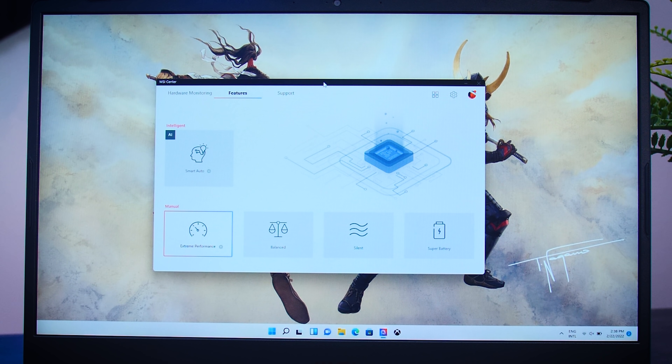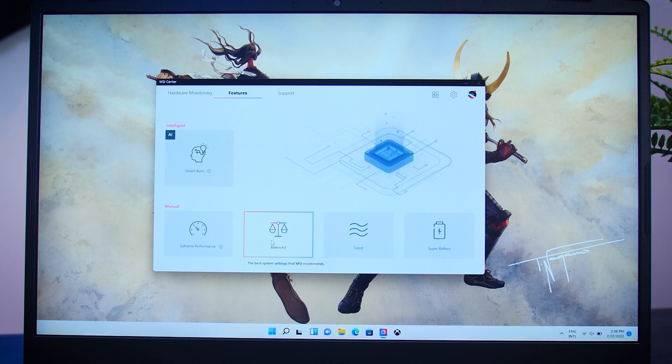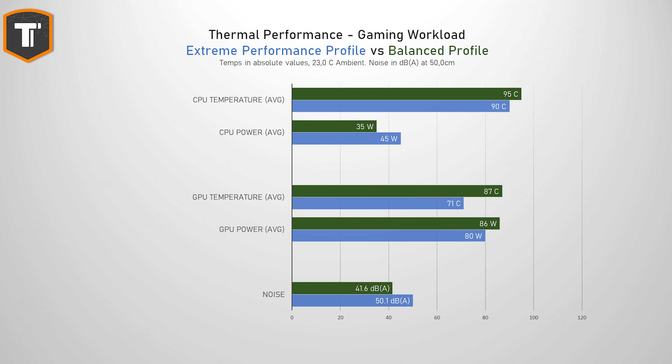You get several performance profiles to choose from. In extreme mode the thermals are reasonable — 90 degrees on the CPU is still pretty warm, but way better than the high 90s some earlier models had, and 71°C on the GPU is completely fine. It does run pretty loud in that mode and I warmly suggest putting on a headset if you plan to game in this mode. The balance mode was a bit odd — it reduces fan speed a lot but doesn't really tune down the total power consumption, so both the CPU and GPU get even hotter. 87 degrees on an Nvidia GPU is pretty high, and 95 degrees on the CPU is not ideal either, so even though balance mode runs quieter, I'm not comfortable with those numbers.